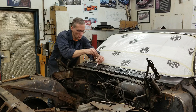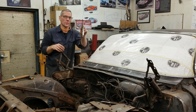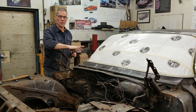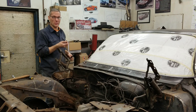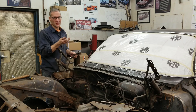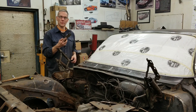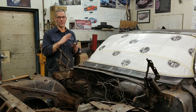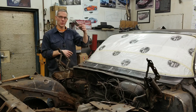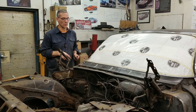We're down to drilling out only one. We got two screws out — no problems — and we're only drilling out the one that broke on us, which isn't too bad. If we had to drill them all out, I'd be complaining a lot more. So this is a little trick you can do to get stubborn fasteners out, and you can do this with bolts too — just keep stacking them. If a bolt snaps off, that's fine: you don't have to grind it off, just take the original bolt, stick it back down, weld it, and work on the next one.